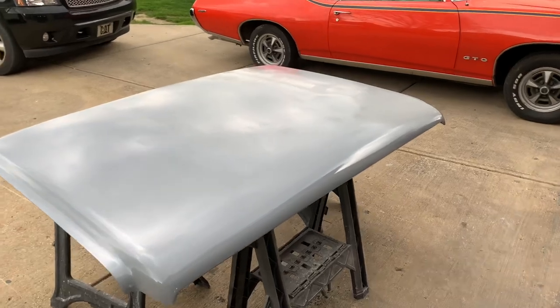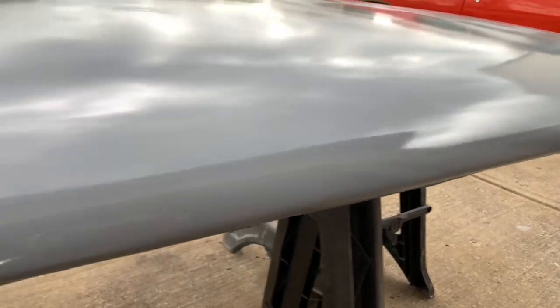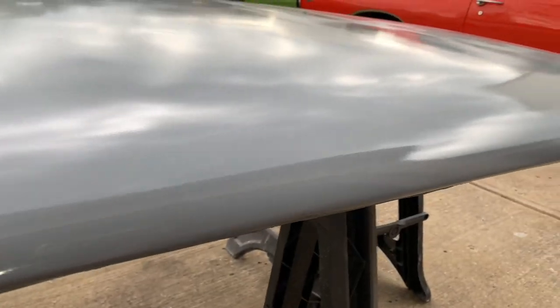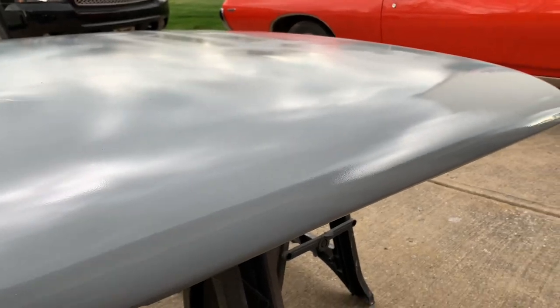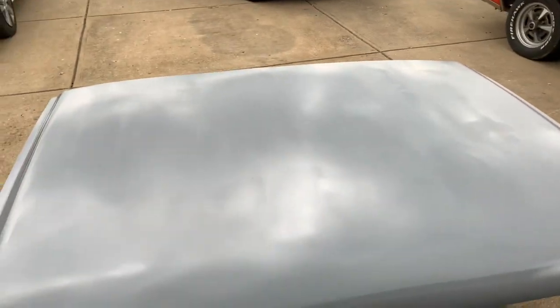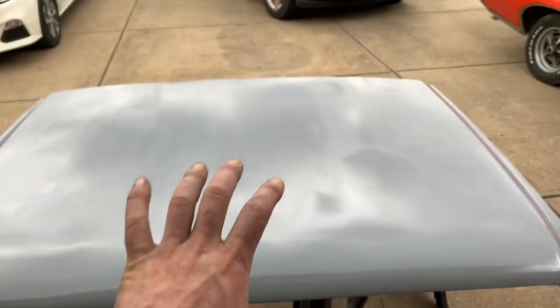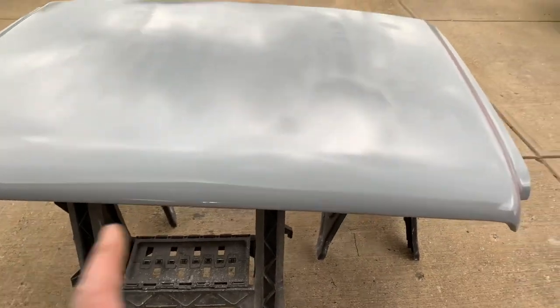Next up: wipe this down and get it ready for a coat of epoxy primer. And — TV magic — came out really slick. The epoxy primer laid out nice on top of the body work. This isn't a finished coat; it still needs high-build block sanding and probably has some blemishes that need filling. But I really need to put this thing back on the car and test fit it, because it was cut in half — who knows if a corner is high or it's twisted. So I need to test fit before doing the final body finish.